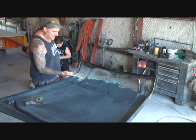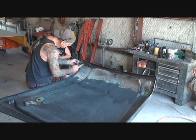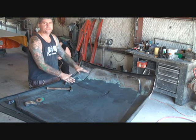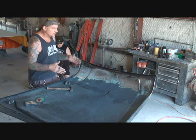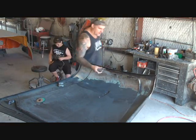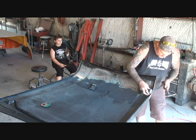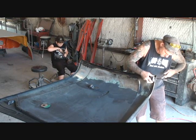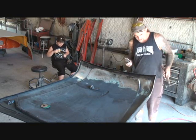We're going to take our hammer dolly — I got two different dollies. This one has a flat surface, so when I pound on the inside. On this particular job, it's very important that you have this edge perfectly straight by the way it fits down in the car. This edge is real close, and if you don't get it right, it's going to rub on the fenders and chip your paint off. We definitely don't want that. So we take our dolly and go all the way around, get that edge nice and straight.